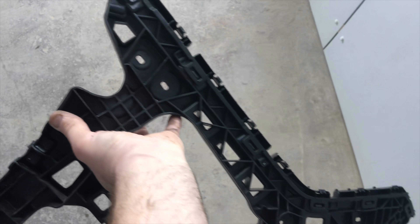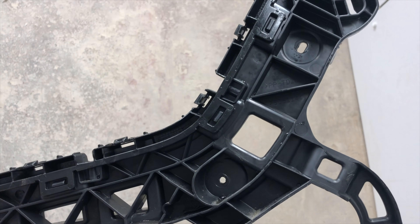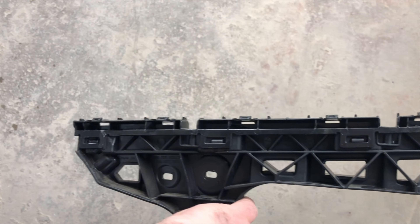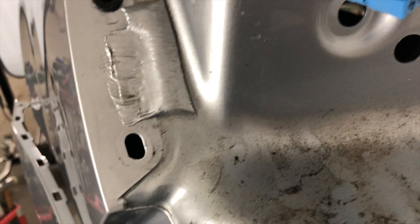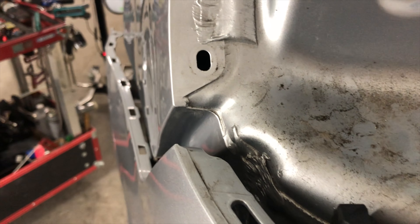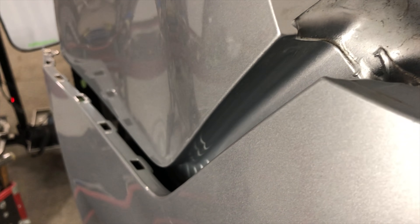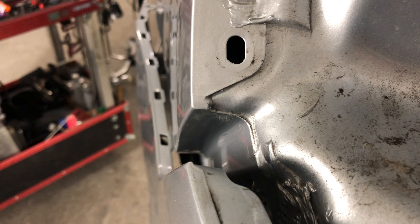The bumper's taken off and the bumper bracket inside has been taken off too. That's this bit of plastic — that's how it fits on. That's where the damage is, that's where the light goes. What I'm going to do is go through this little hole here where the plastic bung goes. It's a no-brainer to try through there first and you can probably see the lines are slightly bent on the edge where the dent is.